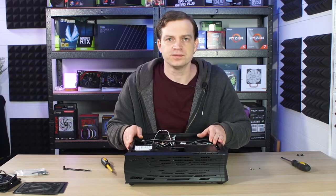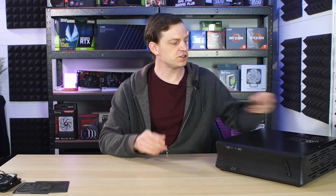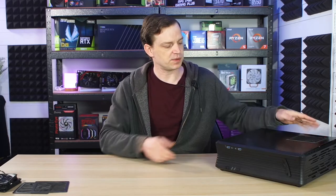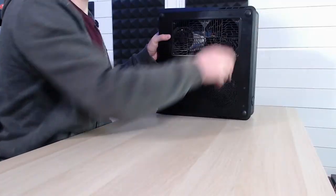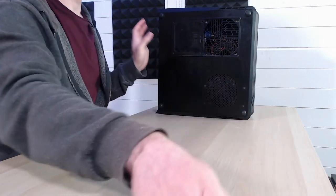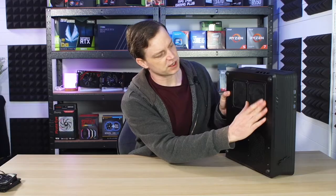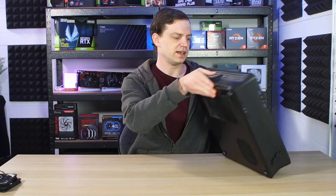There are a few things you may have noticed that we didn't include. One of them was the fans — we didn't want to install fans because we didn't want any extra noise, and for the system that's going into this you don't need the extra cooling anyway. It's a very lightweight, very low power system, and if we do get any issues we can install them later. You can install the dust filters though — they generally just sit inside the top — and if you flip it over you can fit the other two. They're magnetic so they stick; you don't necessarily need screws, although you can use them if you want, but you can just stick them on the side and they'll stay there.